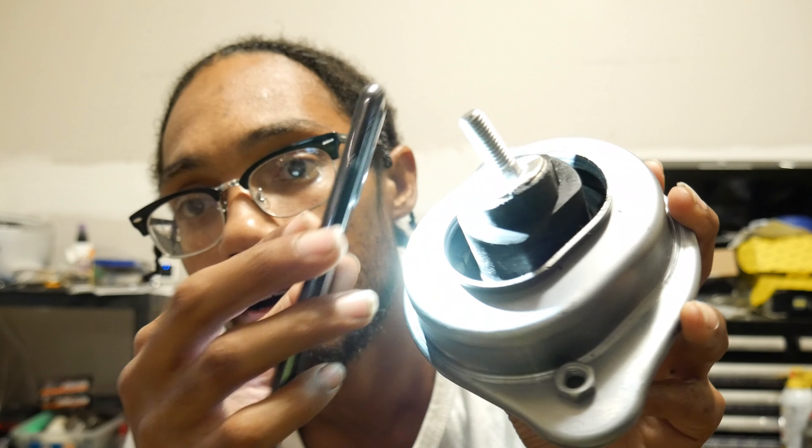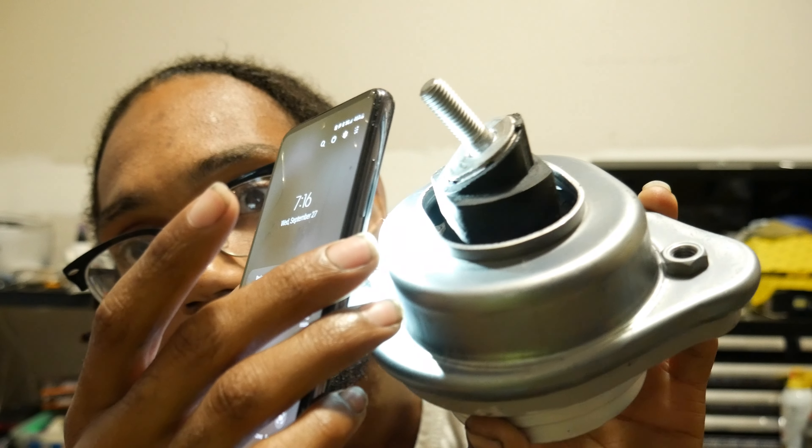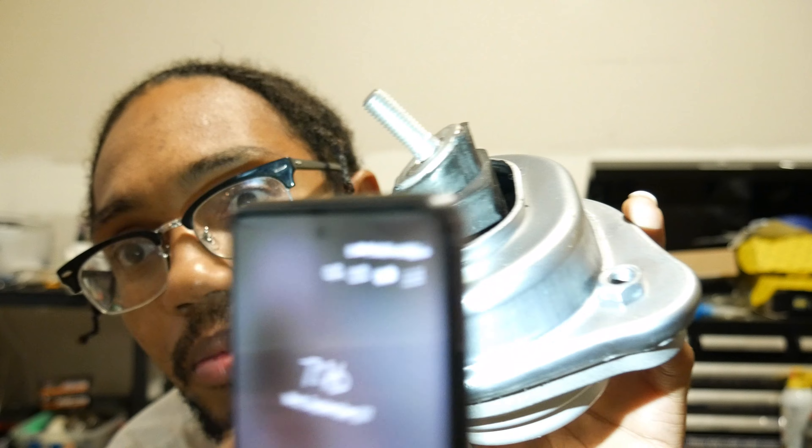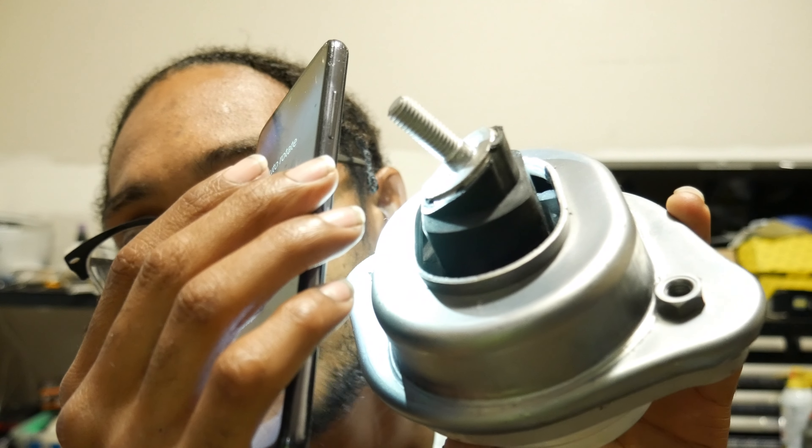The whole goal — if you look inside of it, it opens up to a whole other pocket on the inside. We're gonna fill all the way down there. That's the goal — we want to fill these holes so it'll be solid. I want this to be solid because we eventually want to launch the car, and I don't want to break anything. A hydraulic mount is going to absorb the vibration and not really help — the motor will sink to one side and break that axle.